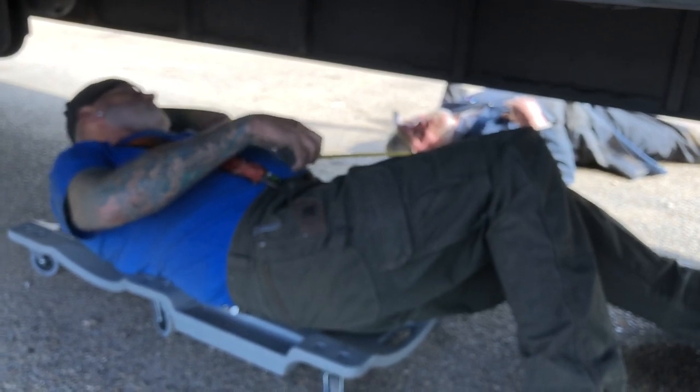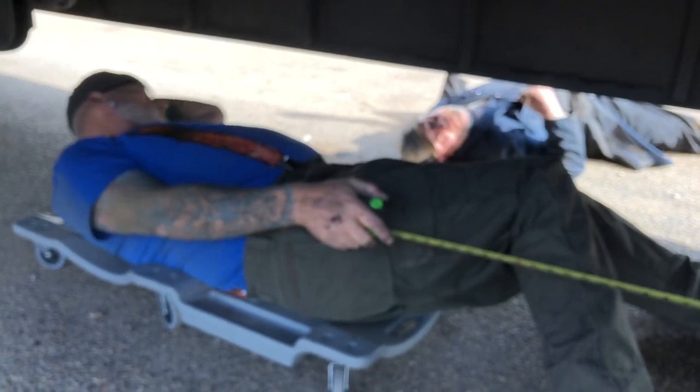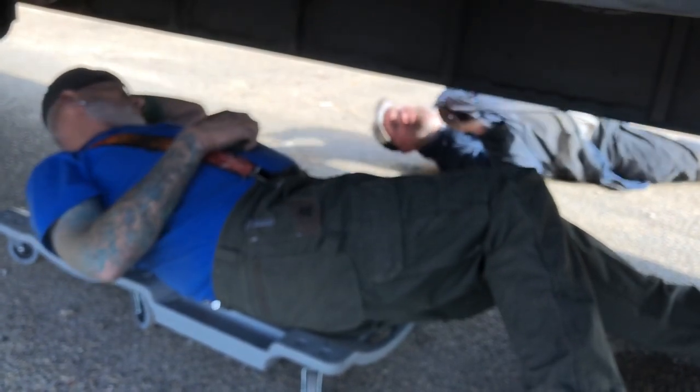They're 4 inches higher. The curb guard's 10, and this is 14 to here. The rear end is 10. The front axle is 10, so the rear end and the front axle all match that curve. Well, they're like 10 and 3/4. You got to have a little bit more give in the middle, because if you go over a hump, that's what we thought. But 4 inches should be enough, I would think. They don't take school buses off-road either.